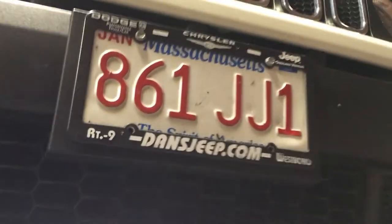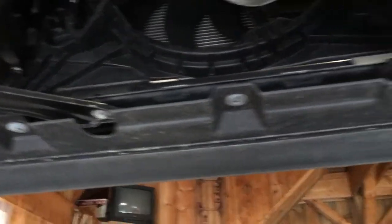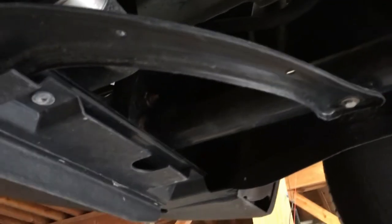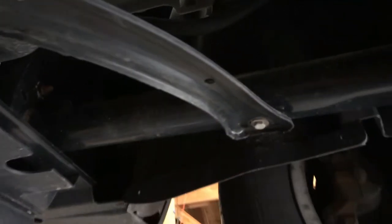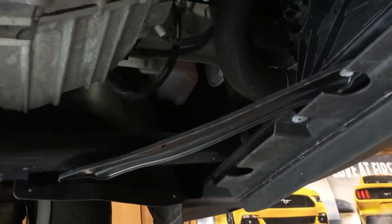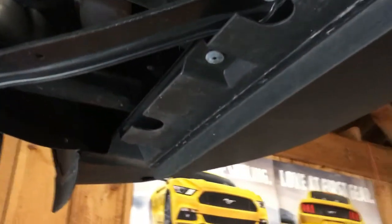So just a little crash support. The front end — inside of here — there's actually going to be an intercooler that's for the turbo, and behind that intercooler, you can see the radiator. In front of the radiator is going to be the intercooler for this car. Because of new crash safety requirements, you'll see that up high, that's your traditional kind of crash structure — that's the frame running out to the front. You'll see down low, you've got these new bars that have been added, typically for the small offset crash test. That's to help really maintain some structural rigidity when a quarter of the car is running into whatever.